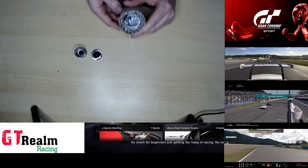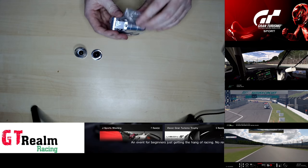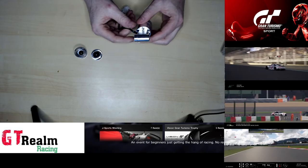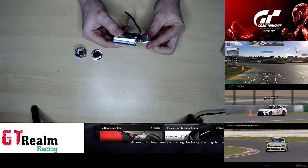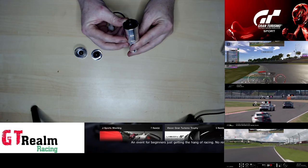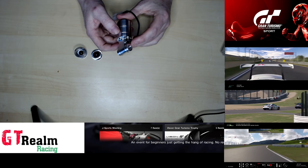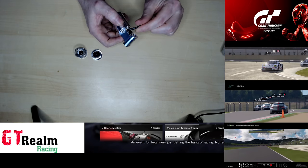And then in this little cardboard tube is the main deal. It's quite a heavy little number, mainly because it's made of CNC'd aluminium. So this is the actual brake mod itself. On first looks, you'd think that looks like a load cell, and you'd be wrong, because it's not a load cell, but it is built to replicate the feel of a load cell. But it actually works exactly the same as the actual brake that's in the G29 at the moment. So it does use a potentiometer.